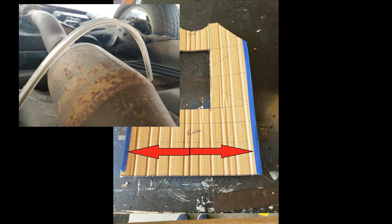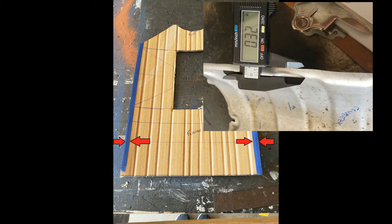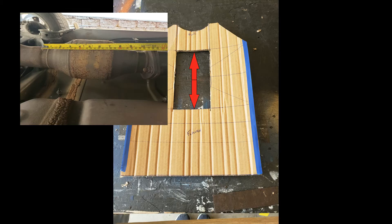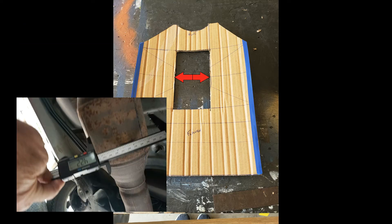To find the width, I used a flexible tape measure. I bent it into the radius that I wanted my shield to be bent at, then read the distance off the tape measure. This blue line on my template corresponds to this flat edge on the heat shield. Unfortunately, the heat shield flat edge isn't really wide enough to make a good attach point. So I'll be tack welding some steel onto that edge to make it a little wider. This hole is to provide cooling, and both the length and width will be a little bit larger than the converter.